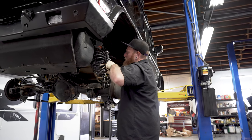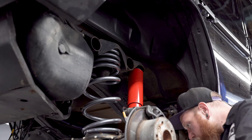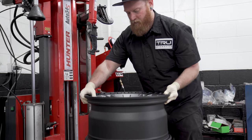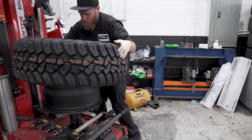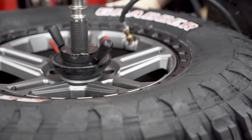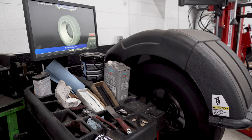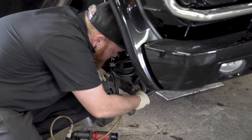A benefit of the non-AMG version of these vehicles is the smaller braking system, allowing you to fit smaller wheels, which allows for higher sidewall protection as well as better air-down potential. For this project I chose Alpha's latest wheel, the Grenade — the best of both worlds: an 18-inch wheel designed for off-road use while having a classy and factory feel. For the tires I went with General Tires Grabber X3 in 35x12.50s — great looking, incredibly capable, and one of the best road manners I've ever seen from a mud terrain. These balancing numbers were some of the lowest I've ever seen. After a quick brake bleed, it's time to wrap this thing up over in the alignment bay.